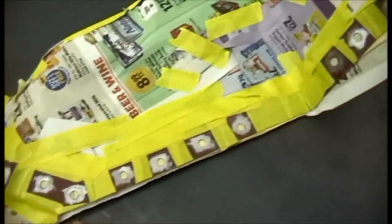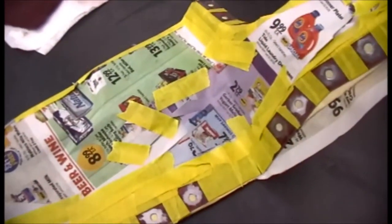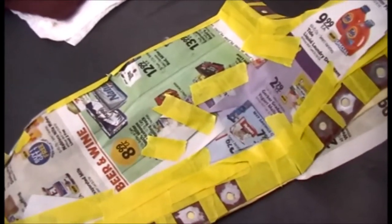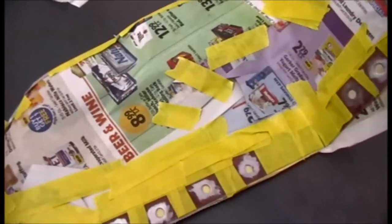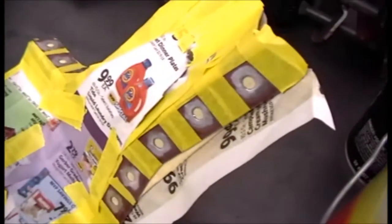The reason I went ahead and taped it up is this will actually get another coat of epoxy, and some of this you'll actually see from the trunk. And I didn't want that weld through primer in there and have to try to sand it all off with the overspray, so it's just as easy to go ahead and tape it up. So I've got that taped. I went over this with a little bit of wax and grease remover and let that flash and get ready to spray it with my weld through.